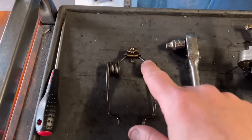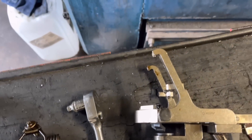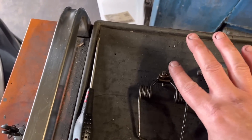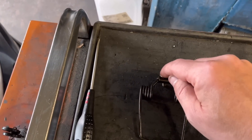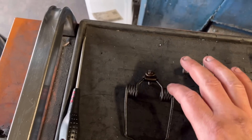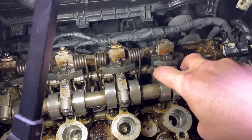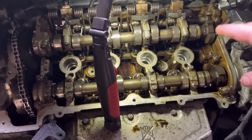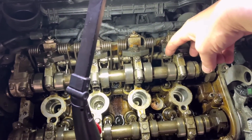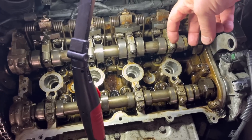We've got a spring here and a bolt — this is the special tool. The idea of this tool predominantly is to close that spring up so we can get the clamping bolt in the top onto that top platform when the spring levers are behind the rockers. The idea of the spring is to pull that rocker between the cam and the bottom rocker into the camshaft and hold it in position.